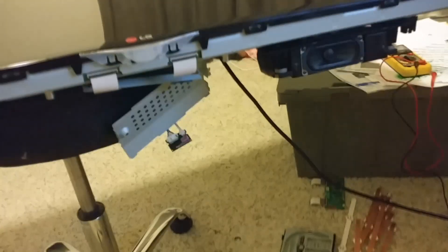I'm looking for the bit — I have my little adapter here, but it's not magnetic and I have carpet that can hide everything. All I know is that it's bigger than a Phillips head 00 — it's probably like a Phillips head 0, or maybe a Phillips head 1. Basically you take out these screws, take out your LCD panel. It's going to come apart into little frames, and then after the frames you're going to have three sheets. Take out those three sheets and you'll get access to the LEDs, and I'll show you from there what happens.